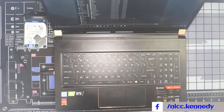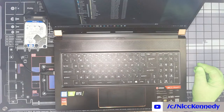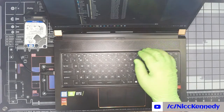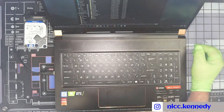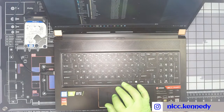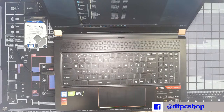Whether it's gonna load and boot, I did not. Did we go into the BIOS on that one? No, that was the red laptop, we went in and switched from UEFI over to CSM boot. Yeah, that was the red laptop, and then we did a system restore. This just wouldn't boot up at all. What do we do with it? Do we scan it for malware? I don't have Malwarebytes on here. No. Okay, so really trying to think, what do we do about this? We can get the data.